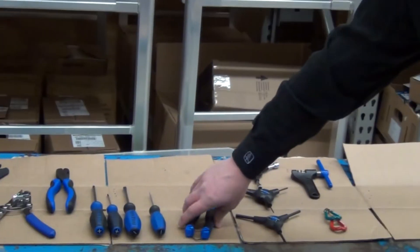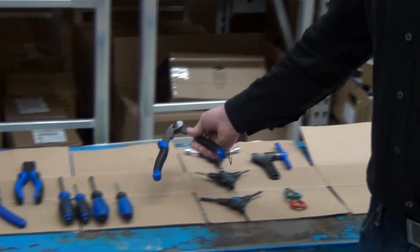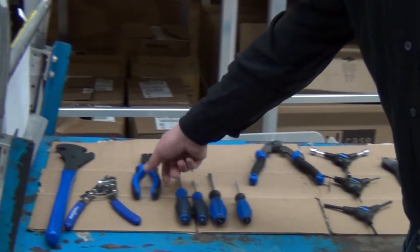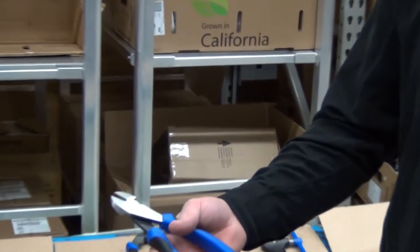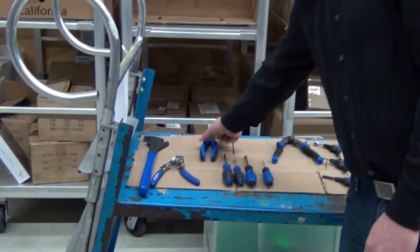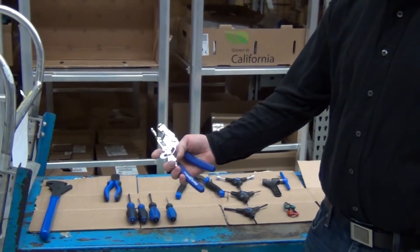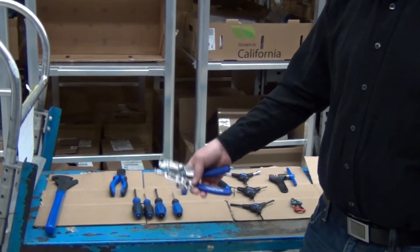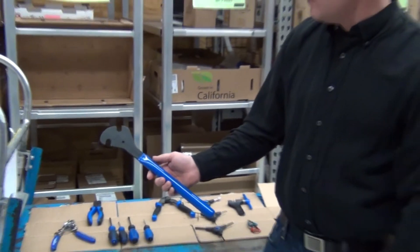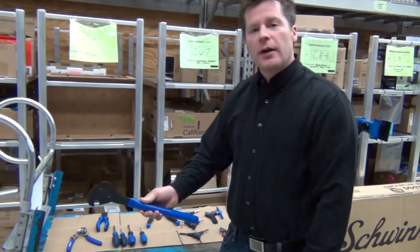We have a housing cable cutter — a more elaborate cable cutter designed for the black housing on bicycles, whether it's brake or shift. We have flat head and Phillips head screwdrivers. We have diagonal cutters, used for cables and brake housing — we'll go over that in more detail. We have what's called a fourth hand tool, which grabs the cable and adjusts it; this is for fine tuning adjustments on brakes and gears. Finally, we have a 15 millimeter pedal wrench with two different sizes to get two different angles on the pedals to tighten them up.